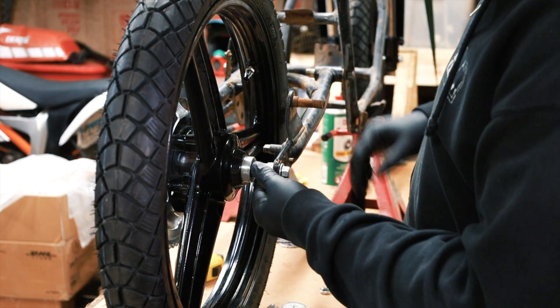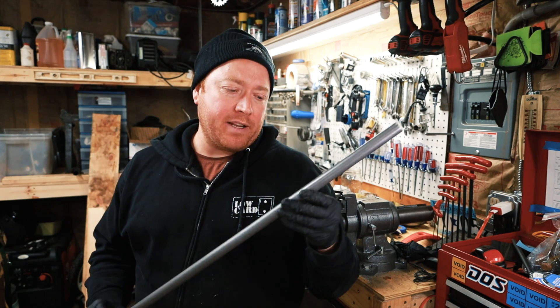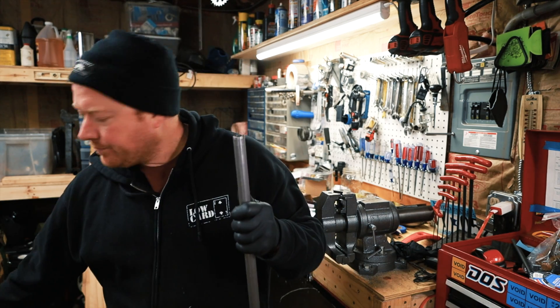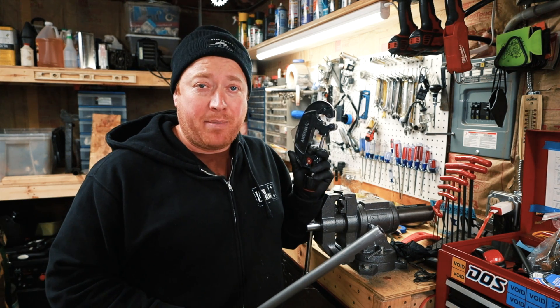So we can now take these out and measure it — 30.12 millimeters. Easiest way to make a spacer is to go to your steel supplier and buy tubing that has a 12 millimeter inner diameter. Your axle will fit right inside of that. You can cut this tubing really easily with a pipe cutter.